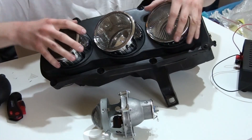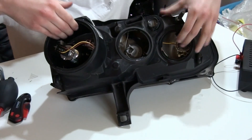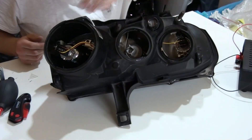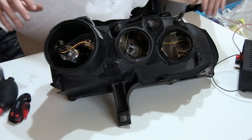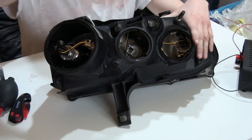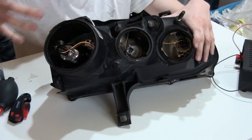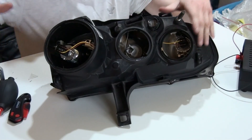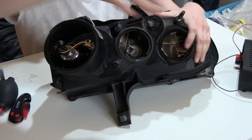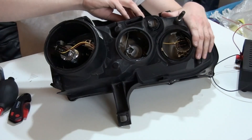About the cleaning of the headlamp: I used around half a liter of demineralized water — I just poured it into the holes after removing the bulbs and without the projector installed. Then I put a few drops of dish soap and gave it a good shake to move all the dirt and debris from the inside. Then I poured it out and flushed the whole headlamp using around 2.5 liters of demineralized water to rinse out all the remains of the dish soap. Then I installed the bulbs back and ran it for a short while to increase the temperature inside and dry the headlamp from the inside.